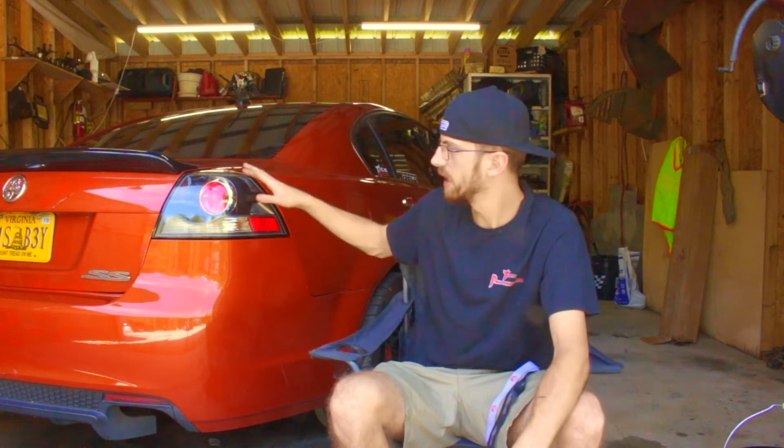So once I'm able to drive this, I cut my old MagnaFlow exhaust off. It's 2.5 inches. I'm going to be custom making a 3-inch exhaust. I'm going to make it long enough so it goes past the trans and goes into an X pipe, and then goes back to back here. Just so if I ever have to do anything to the transmission, you can easily source it.